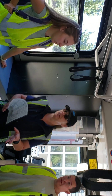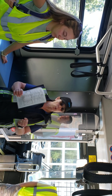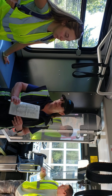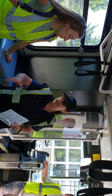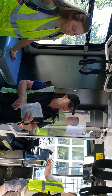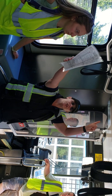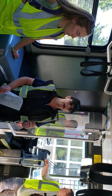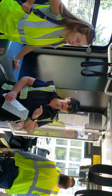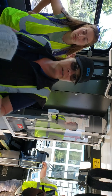So we're going to check the seating — make sure it's secure, no loose or missing nuts or bolts. Go down and give them a little shake, but don't rip them off the frames; just say this is how I check it and I would check them all the same. You're also going to point out the emergency exits. We have both doors, two roof hatches, and any window with the red handle. You're going to have to go down and point out each window individually and say 'this is an emergency exit' for all the ones with the red handle. Walk down the bus pointing them out, and make sure they're all properly labeled as an emergency exit with instructions on how to use them.